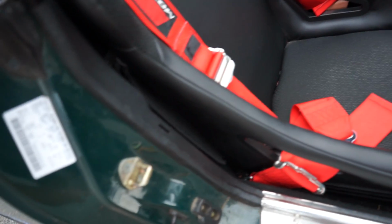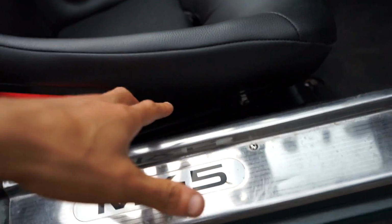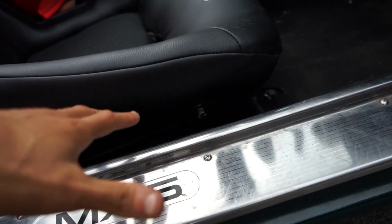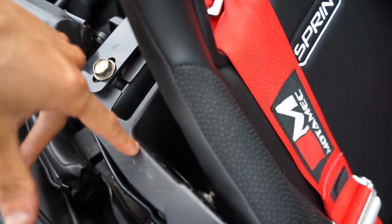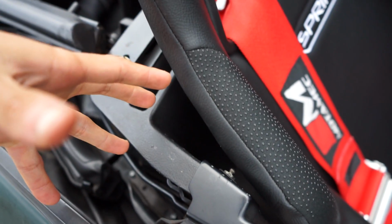And obviously I can't actually move these seats because they are sitting on fixed brackets rather than on the standard rails, so they can't move forwards and backwards, which would allow for the striker plates that the hardtop roof latches onto to be in place there. And now you don't actually need to have that tied up on the car, or so I've heard according to forums again, but I would prefer to have them on because it reduces the flex of the car. When those two sides are actually done up, the car doesn't flex so much, and that's good also for rigidity.